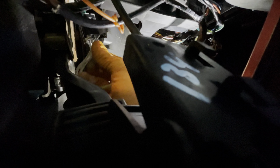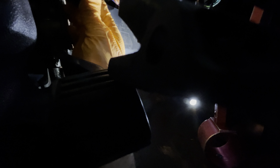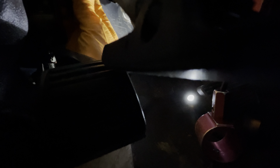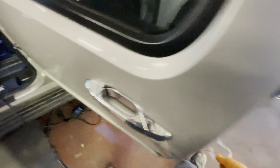Okay, got that panel removed. Here's that splice pack we were looking for — going to have to repeat the same test procedure as the other one. Now that I know the problem is further downstream, I'm going to go ahead and reinstall this splice comb — splice pack, whatever you want to call it. Now watch what happens to our network activity when I remove this splice pack. Right now we're shorted to ground — it's just a flat line, zero volts. Look at that — came right back to life.